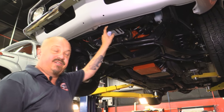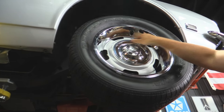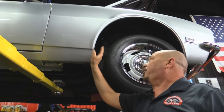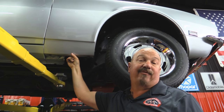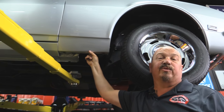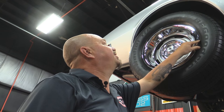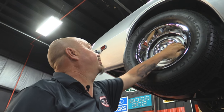Let's look at these wheels and tires. Up front we've got BFGs — 215/65-15s. Rally wheels look like they've got new paint. Center caps look new, trim rings look new. The lips on the front fender — I always feel around back here, it's nice and smooth back there, not a rotten fender. A lot of times guys patch those up and you can actually feel it in the back — this one's nice and smooth. Out back we've got a lot more rubber trying to plant those 411 gears to the ground — 275/60-15s. Looks like brand new center caps, trim rings, and those rims are beautiful.